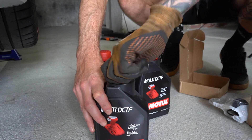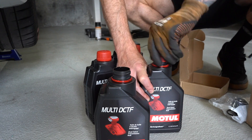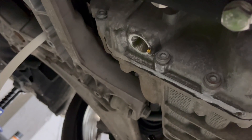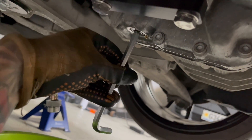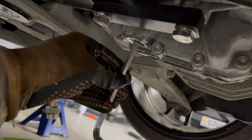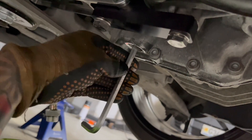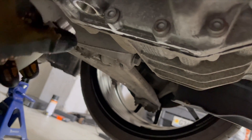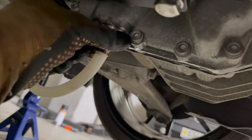That's draining. What I'm going to do is crack the lids on all of these. So that's finished draining — looks pretty dark. I'm just going to put the 8mm plug back in. No need to go super tight; I'm going to do finger tight — it really wasn't hard to get out. And then we're going to connect the fill hose. Ready to start filling.